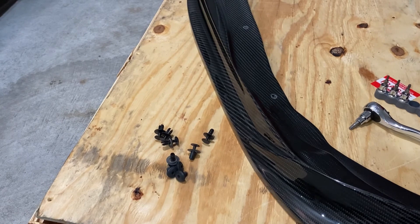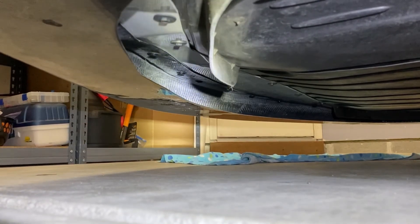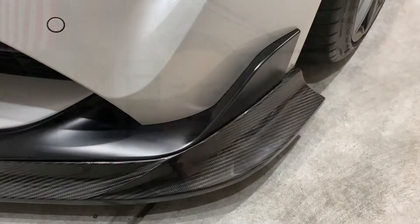With the car propped up, I used the OEM plastic fasteners — I've got one that's sticking out a bit and needs to be pressed in more, and in the center is your T30 Torx. The install was super easy, everything lined up. It's just some awkward angles to get into for the T30 bit and the plastic pop clips. Big shout-out to LG Motorsports — the alignment is just perfect regarding where the fasteners sit.